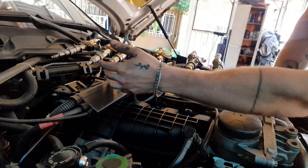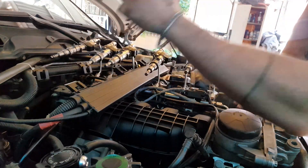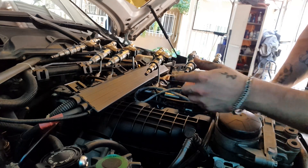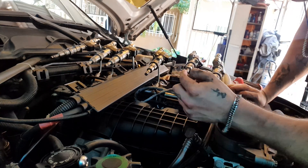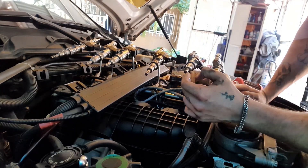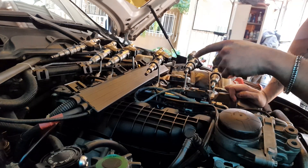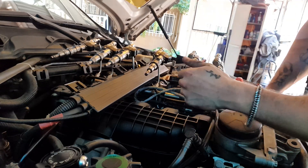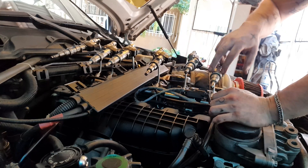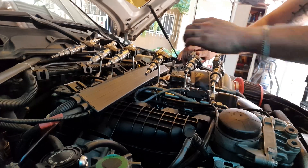All the points are very dry so I don't think I've got leaky injectors, but they might be dirty as hell. I'm going to clean this tip with an oil solution just so it doesn't look so bad. Then I'm going to put this injector back into place because it's leaking at the fitting and I can't make it tight. So I won't know if this one is leaking, but then we can build proper pressure on the others and see if any one of them has a leaky tip.